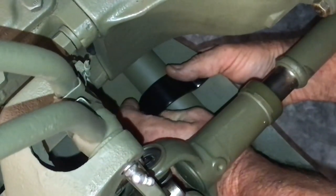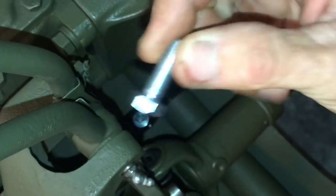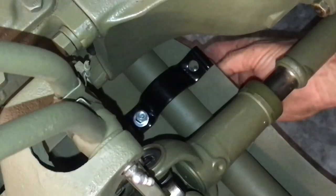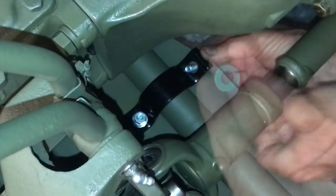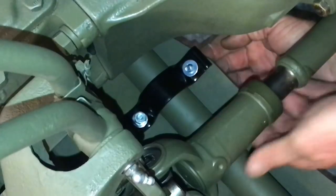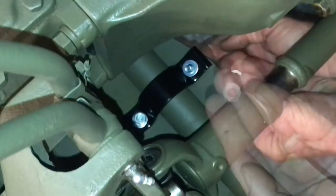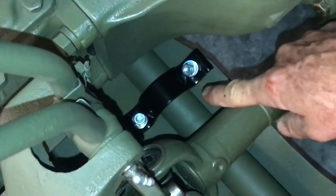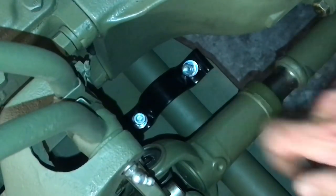The premium muffler mounting kit from Ron Fitzpatrick Jeep Parts has all USA-made fasteners. Here's the bolt that fastens the front of the clamp — I've ground off all the modern markings. Insert the bolt upward into the skid plate with the head facing toward the ground, then install the flat washer, lock washer, and nut. A detailed part list of all bolt sizes is included in the kit. I'm only finger-tightening these fasteners because I'll need some movement when I reinstall the skid plate, and I'll also need to adjust the clamp forward, backward, or in and out when I install the muffler unit itself.